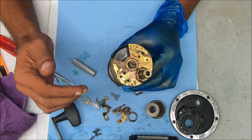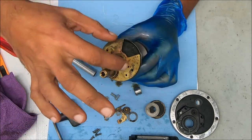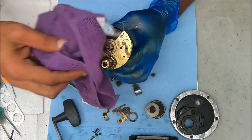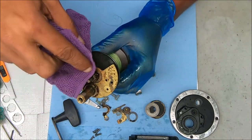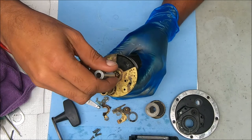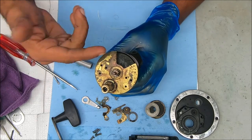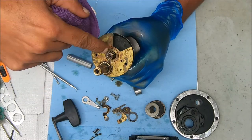So let me tell you what I did — I was not recording. What I said earlier while not recording is that the heat wasn't working to the point I wanted and the spool was getting really hot. So since we had some play in the bridge, we had some room to work with that pinion gear. What I used was a press to push down on this. I've only done it once so far, but we're probably going to have to go back and forth a couple of times to get that pinion gear off. The goal is to not damage the pinion gear so we can reuse it. I used the press to push down on the pinion gear and it moved.